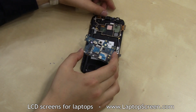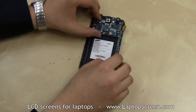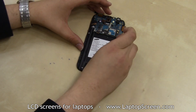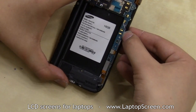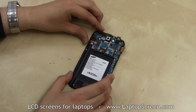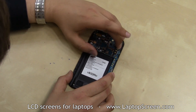At this point, the logic board can be installed. Carefully position it in place, ensuring that no connectors are getting caught underneath. Reconnect the bottom right connector and secure one small Phillips screw. Reconnect the small connector at the bottom right. Reconnect the WiFi antenna connector, making sure the WiFi coaxial cable is properly routed under the logic board. Secure five connections at the top — all connectors make a distinctive click when connected properly. Please be careful as the connectors are extremely fragile.